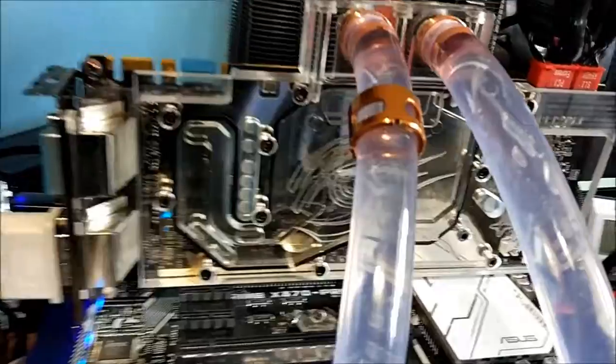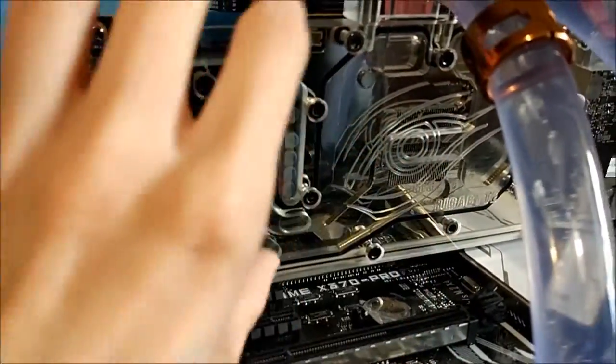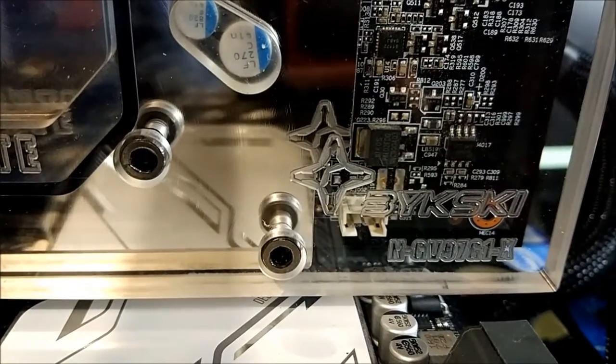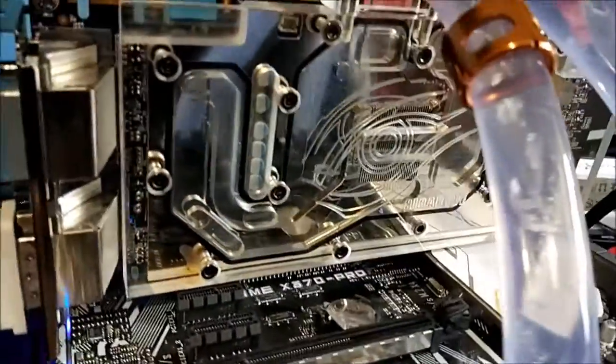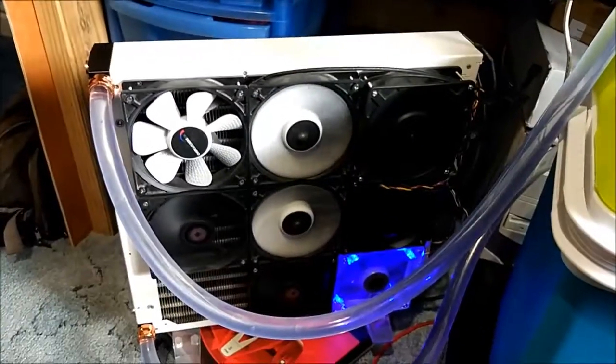Yeah, it's a pretty good result overall. I don't know whether it will improve my max overclocks on this GPU at all, because I've tried it underwater with a monoblock just over the GPU core with a fan blowing on the VRM. But I'll have a go at that now and see what it can do. I would kind of recommend these because usually the Bykski water blocks are a lot cheaper — usually about half the price of an EK one for a full cover. And the performance versus the air cooler is pretty good. I'm running my usual 1080 radiator setup but with only seven fans going, and obviously the pond pump which is in the cool box, so I do have plenty of cooling.